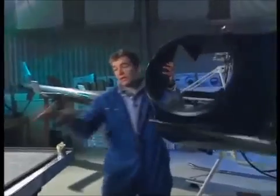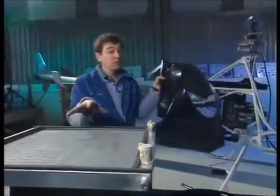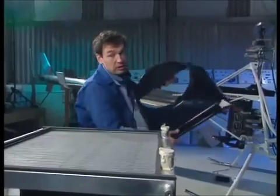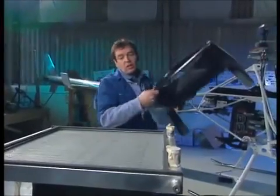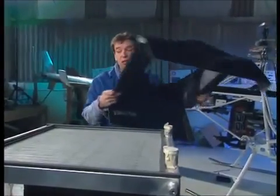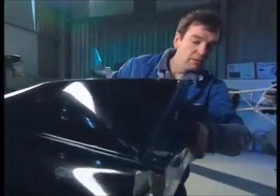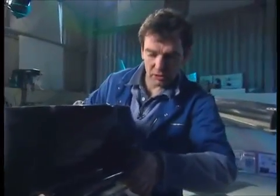Next, I can fit the shroud. Now, you're probably thinking that is a big radiator for not a very big engine, but the way helicopters work is that the engine will be going at over 4,000 revs permanently when you're actually using the helicopter. So it does run very hot, meaning it needs a serious amount of cooling — hence the big radiator that drops over like so.